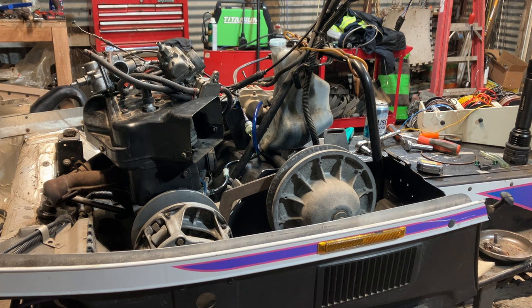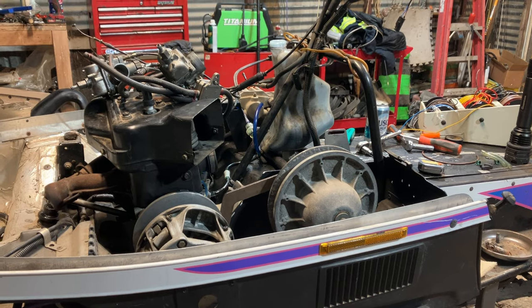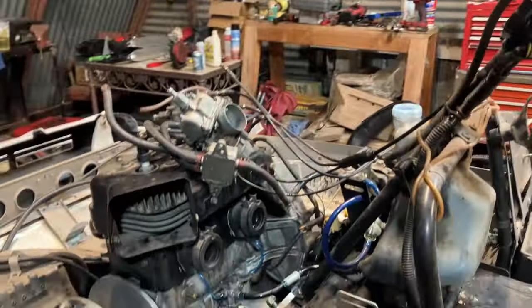Motor set in. I went through the drive clutch and put the weights back in it. We had robbed the weights out of it for a different project. Put them back in there, just gave it a quick and dirty clean. Found a clutch bolt for it. We were just looking at the center to center on the clutches, right on 12 inches, so that's good. And then we were just gonna check the offset measurements with our straight edge. I'll get Spark for that later. And then threw some new oil lines on there.